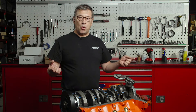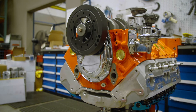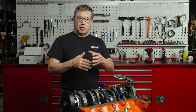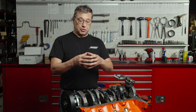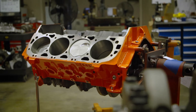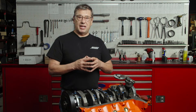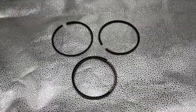That throws a lot of oil around. Also with the thicker block we have thicker cylinder walls, so the walls don't flex. When your piston is going up and down, you can run a nice true cylinder that's nice and round and straight, and you can run very tight clearances. Again, that prevents any oil from trying to go up the side of the piston past the rings.